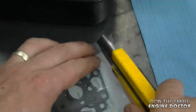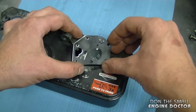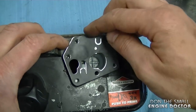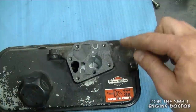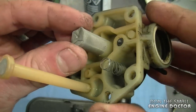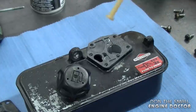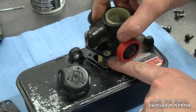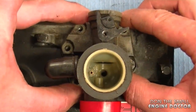So now I'm going to open up the package. You want to grab the diaphragm and install it first on the fuel tank just like this. It's very easy because you're going to see that it only fits one way — all the holes will line up as well as the shape of the diaphragm to the fuel tank. And now you want to install the gasket — again make sure all the holes are lined up. Before installing your carburetor you want to make sure that the screen over here is very clean, and you want to make sure that your small spring is still attached to the carburetor. Now insert the tube inside this hole here — you can hold the gasket and diaphragm when you do this, then just bring it down. Line up the holes on the carburetor to the holes on the gasket and diaphragm and to the holes on the fuel tank.